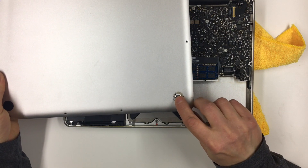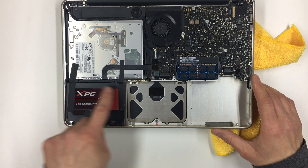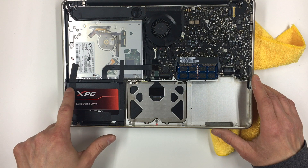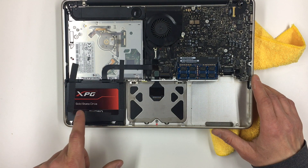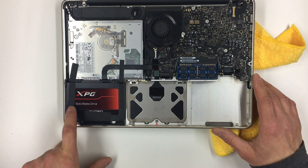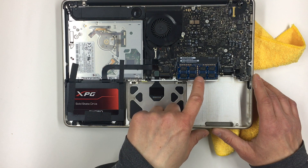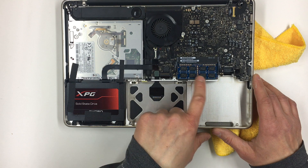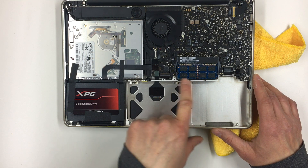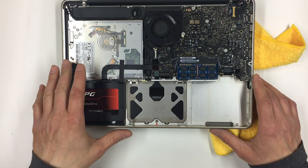The bottom plate needs a foot. You can see I put an SSD in here — there was no hard drive in this when I got it and it didn't have the mounting screws. Since it's an SSD and pretty light, I just used gaffer tape to hold it in place and that seems to be working fine. But if I have to order the new battery and the foot, I might as well just order a set of screws for mounting in the drive. Then I'll have this 2012 MacBook Pro 13 completely refurbished. I even have a set of DIMMs from my old 2011 MacBook Pro — 16 gigabytes of RAM — so I may try and update this to 16 gigabytes as well. If you're interested, let me know and maybe I'll do another video on the upgrade. That's going to be it for now, I will talk to you next time. Thanks for watching.